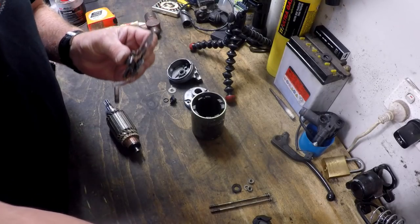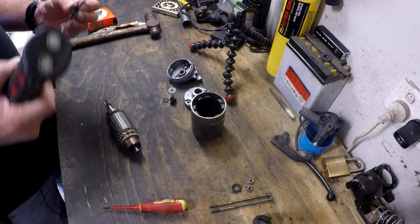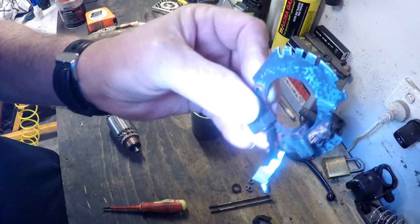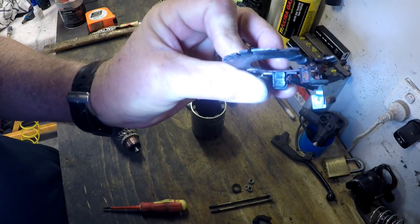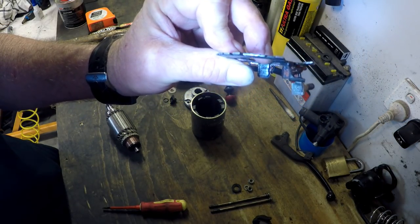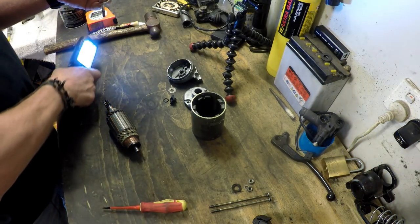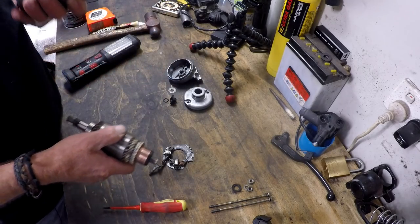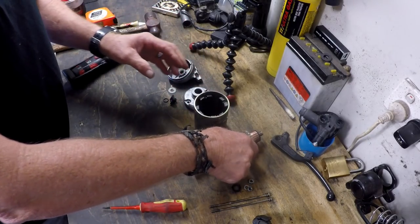Let me throw a bit of light on the subject here. The failure analysis is arcing across this brush — it's all pitted, black, stained and horrible because it hasn't been making proper contact with the commutator. The commutator itself checked out okay. These are what they call a lap-wound armature — you just need to check whether you've got continuity between them all, and that checked out fine. None are going to ground. Bearings are alright. The magnets are fine now that we've glued them in. So yes, I need to get some new brushes.